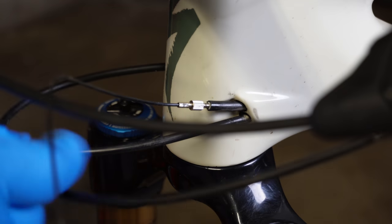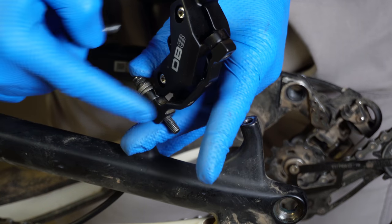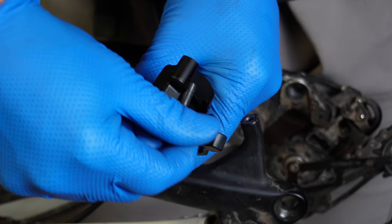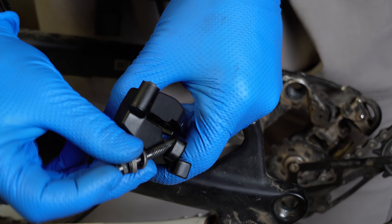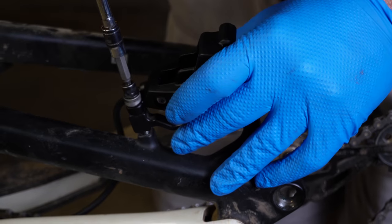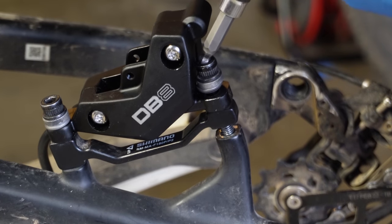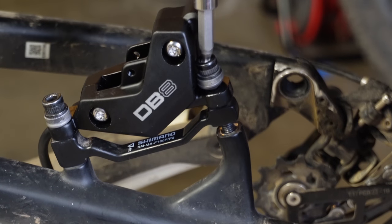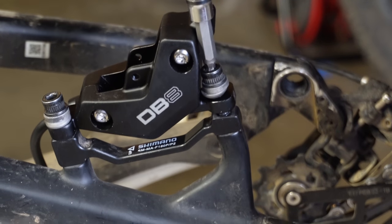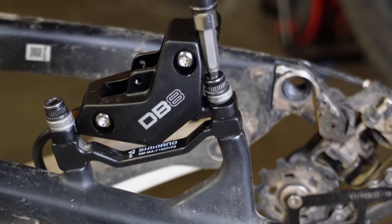It's linked in the description just in case you have internal cable routing. We are installing the rear brake caliper on the bike. I've got the front bolt through the brake adapter — very special note on the SRAM DB8 brakes: the caliper is really chunky on the back, so you've got to wiggle it in from the side like this. Because the SRAM brake caliper is so chunky, we've got to use a ball-point allen key to come in at an angle. Make sure the bolts you're using have quite a bit of thread because we want a good bite on the brake caliper.